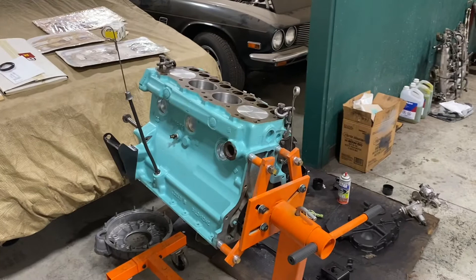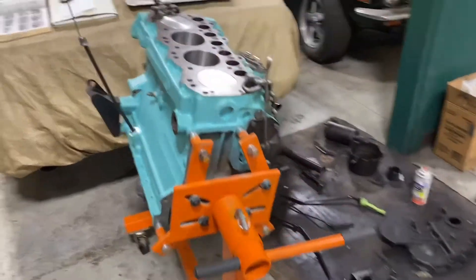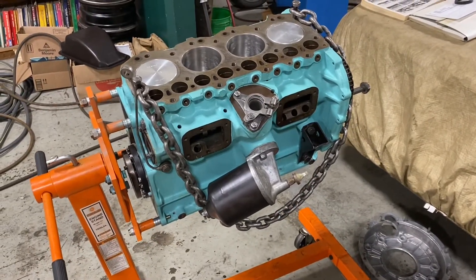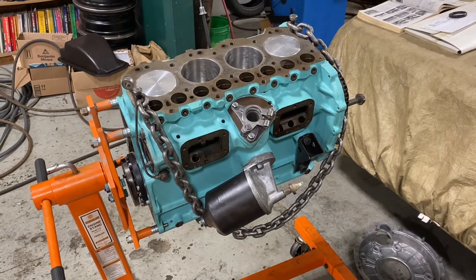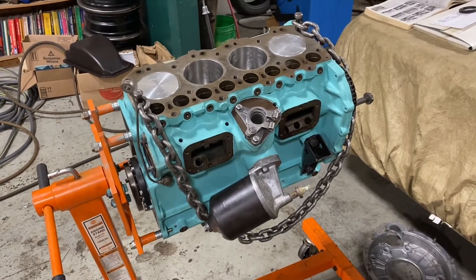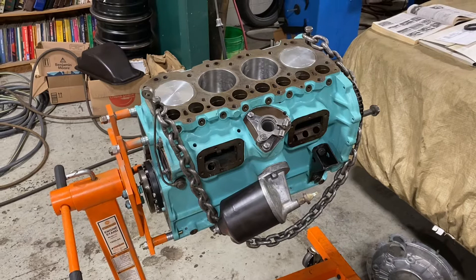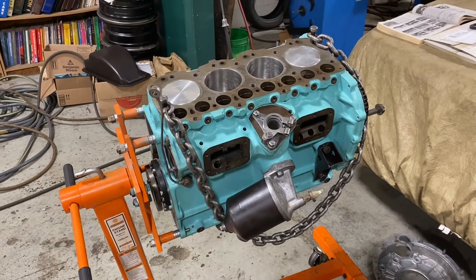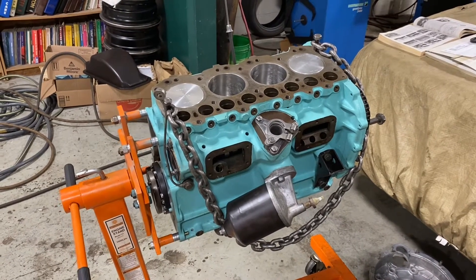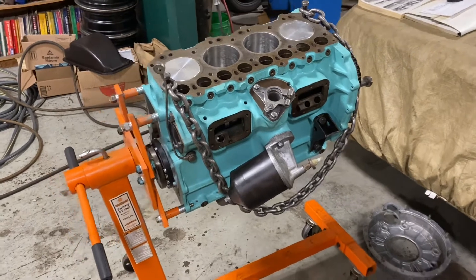What we're looking at is the Land Rover Series 2A engine. Just a brief history of the engines so these make sense to you. The Rover car company would have put their 1600cc F-head engine in the Series 1s, later bumped up to 2 litres. That original four-cylinder inlet-over-exhaust F-head engine was used for approximately the first 10 years of production — very quiet, very smooth, but only had 52 horsepower. The need came for a much larger and more powerful engine, which was met in the Series 2s, with a new four-cylinder two-and-a-quarter litre engine.